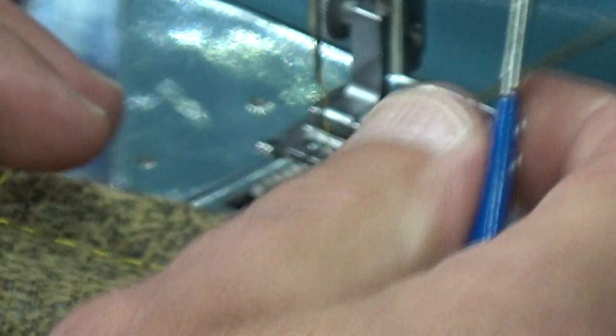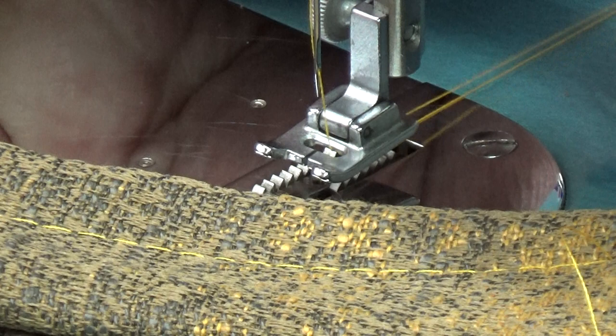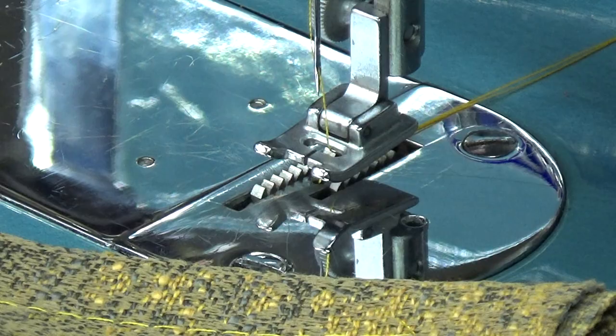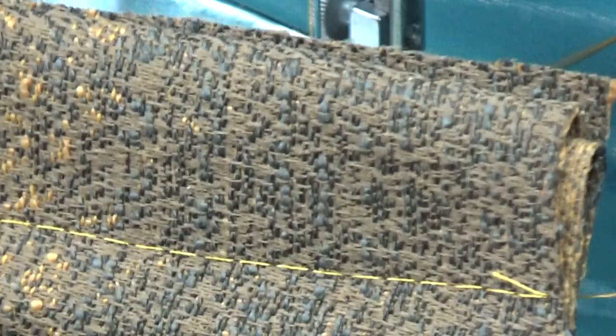And if you didn't notice, a couple of the times when I would sew over my own thread and I had to go through that cleanup process, it's because I was forgetting one of the most basic rules about most Class 15s, but particularly the Class 15s made in Japan. Because of that oscillating hook system and the way it advances that thread, holding on to the tails of the thread when you're initially launching is a necessary evil. You got to do it. And I was trying to do it without doing that. You know, being the confident expert, world-class aficionado of sewing machines, I thought, well, I don't need to do that. Well, you really do. And it eliminates a major headache of that thread being misfed in the throat and sewn over as you're going through the sewing process. So all of that blah, blah, blahing is don't get lazy like me, okay? Don't get lazy like me.